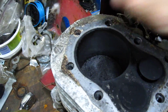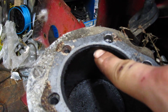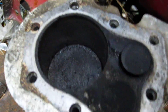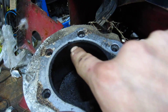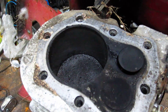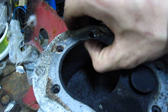One way to tell if your rings are bad or if the cylinder needs work is if you actually take your fingernail and see if you can find a nick on the edge here — try to find a clean spot because sometimes carbon will build up around the edge. I can't feel any nick. Sometimes when the piston travels up and down, the rings are down a couple of millimeters, so the rings tend to wear a groove. Sometimes older engines will smoke — they'll burn a little more oil than they should, or they'll smoke blue smoke a lot. That can be caused from a cracked ring, or having a rough cylinder if it's all scratched, or having a really worn cylinder where you can feel a nick. It should feel like a little nick with your fingernail. This one's good — I can't feel anything.